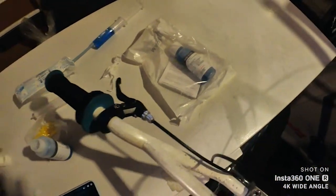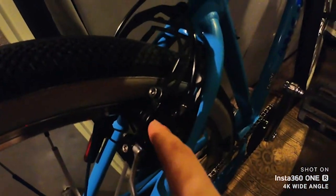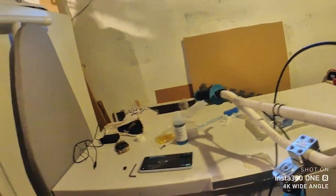I've got a mini bleed kit from Magura which has the Royal Blood Hydraulic Fluid, the syringes, some extra hardware and things. I'm going to unscrew this bolt, which I just did. You're going to fill up the syringe with about 25 to 30 milliliters, put that hose on, screw the bleed port on there, and then attach it right here.